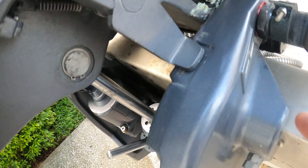Sorry for the background noise — they're working on the yard. Another thing I forgot to mention: you can see where the water was from the storms. That means my trailer was submerged underwater, which means my bearings and tires were in the water for a couple of days. So I took off these caps — buddy bearings I think they're called. You just grease them, make sure they're packed full of grease, close it up, and you should be fine. Now I'm just going to hose the trailer down so all the salt water can come out.